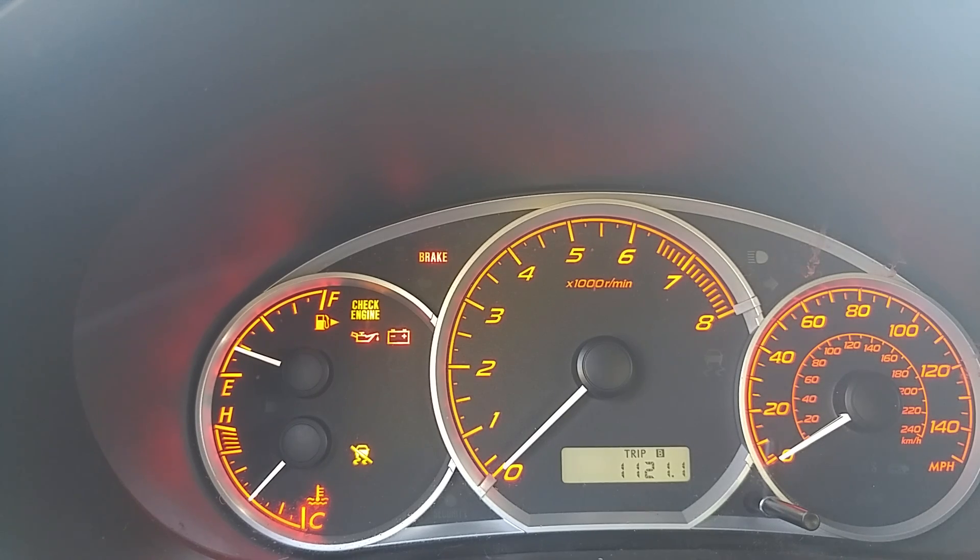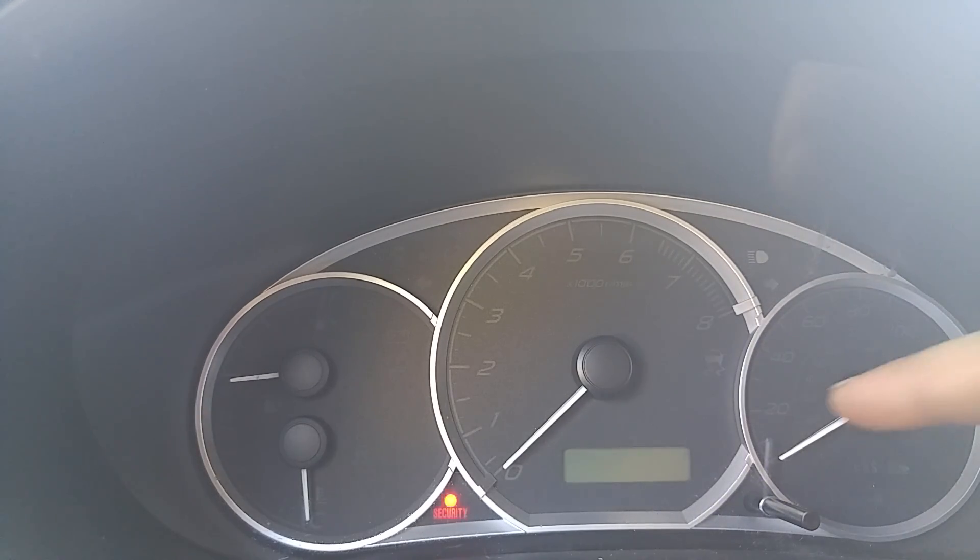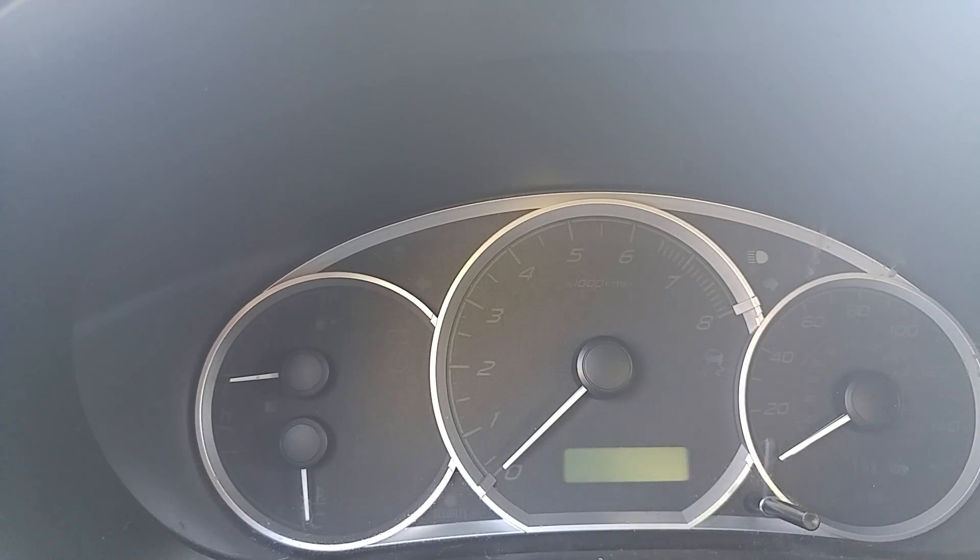So you've got to make sure your headlights are off. Turn the key off and take the key out. What you want to do is when you turn the key on, push the information display button — this button right here — and also use the headlight switch. I'm going to show you how to do that. You've got to do this quick for it to work.